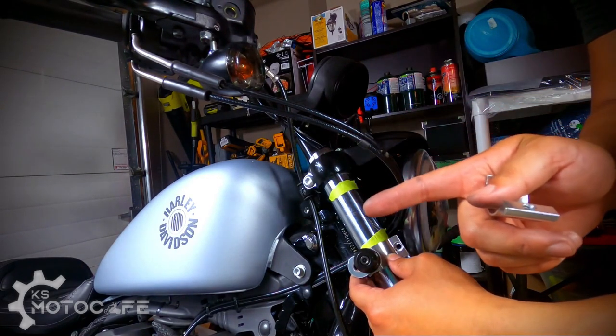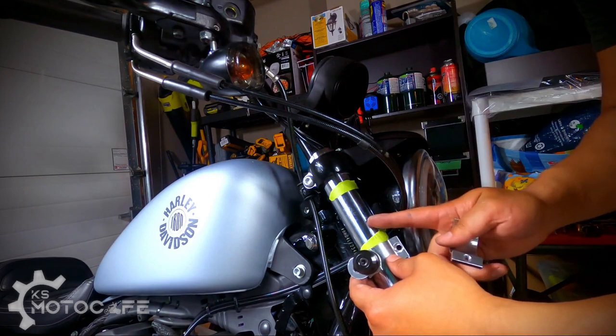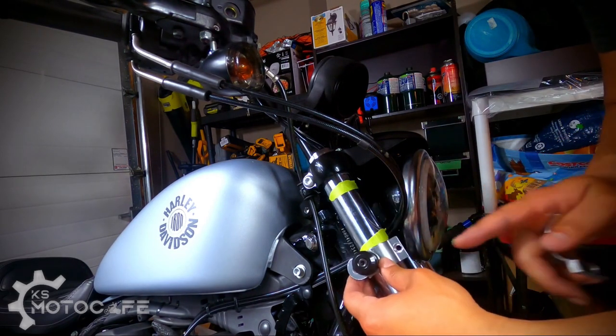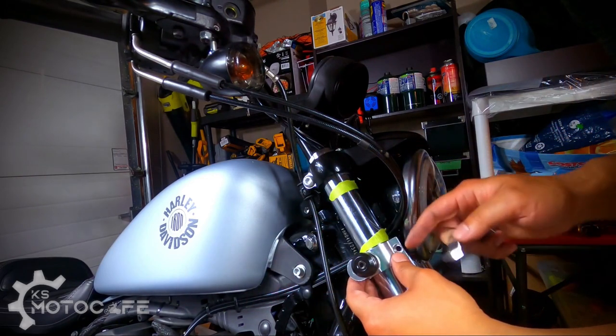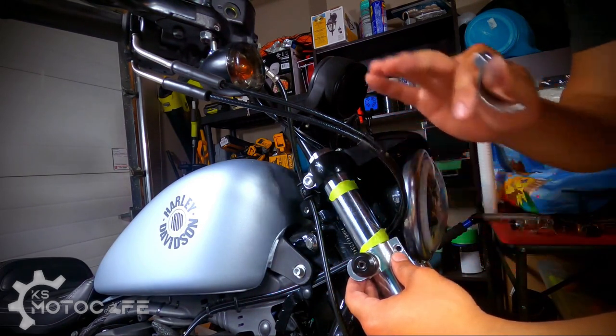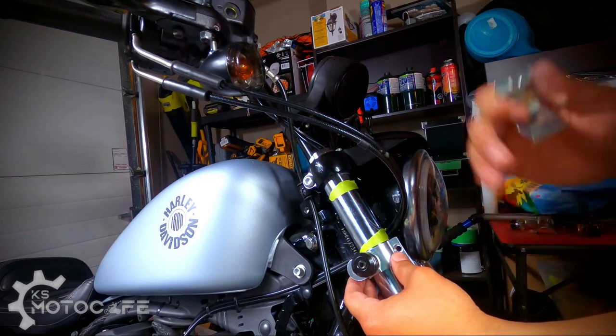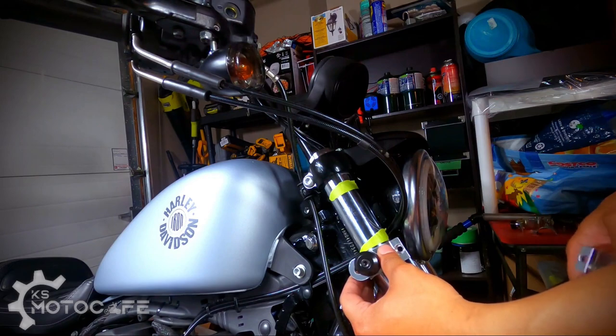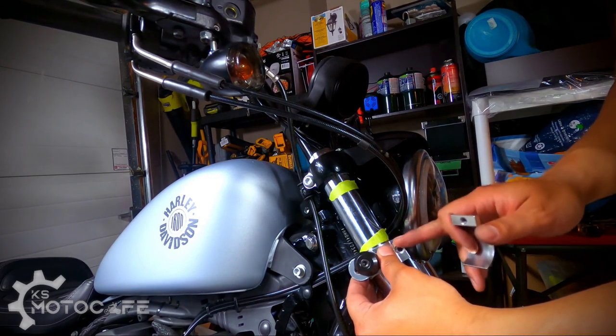I know the manual says something different, but for this particular bike, which is the Iron 883 from 2020, having both top and the bottom looking this way and screwing in front works the best and makes everything look flush. So that's how I do it. And if you find something different, please leave a comment below and let me know how I did it wrong. But for me, this is the way it works.